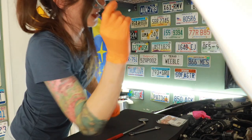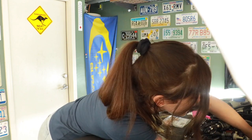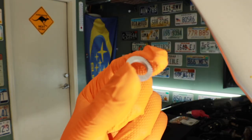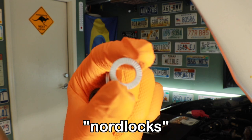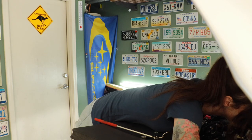See this right here? This gasket. This gasket was missing when I bought the car. That means it was leaking pre-turbo — it had a huge exhaust leak before the turbo. I got some new washers — they're toothed.